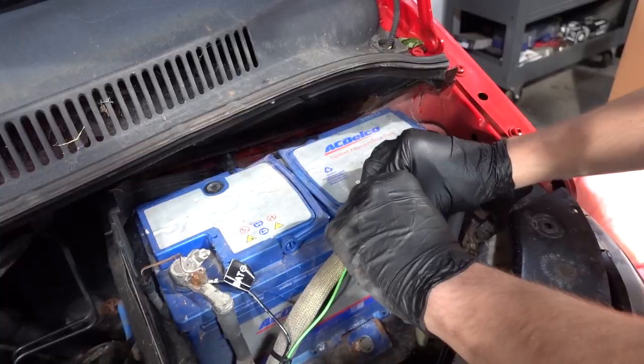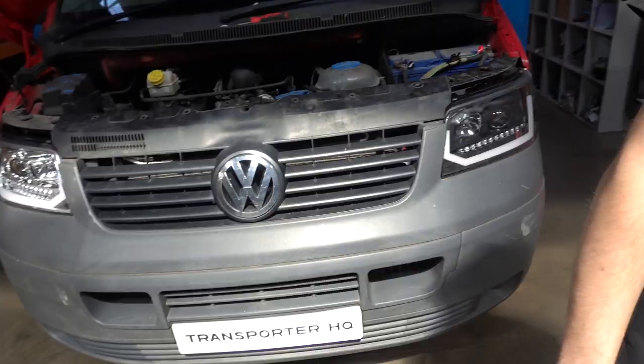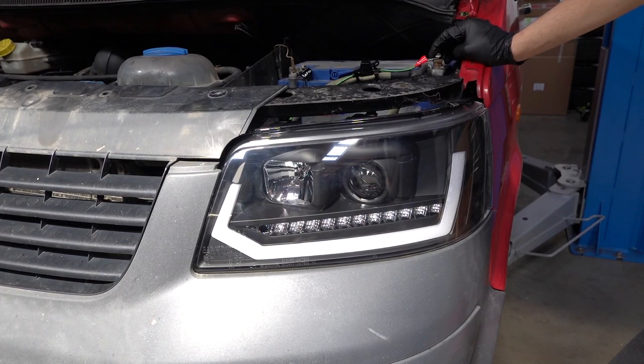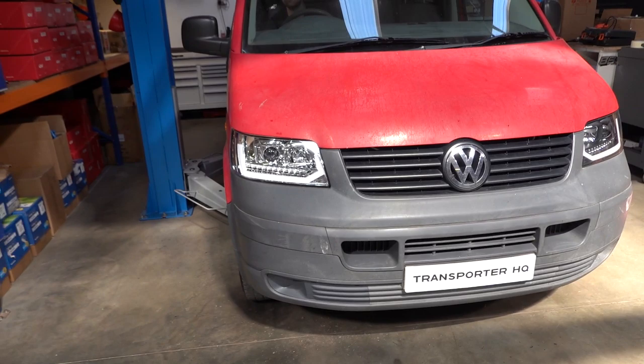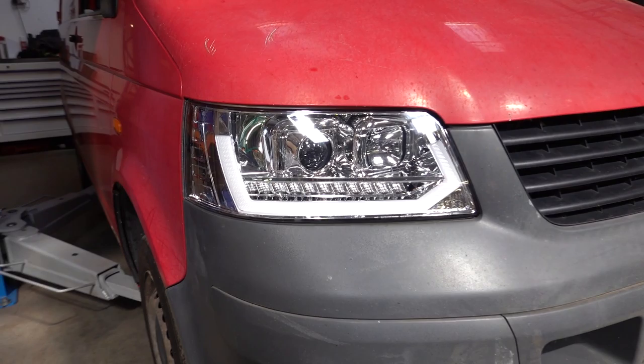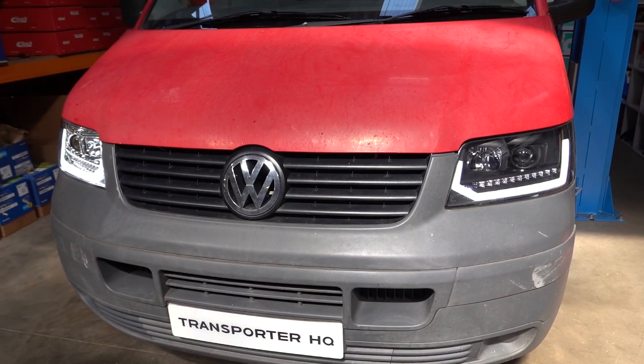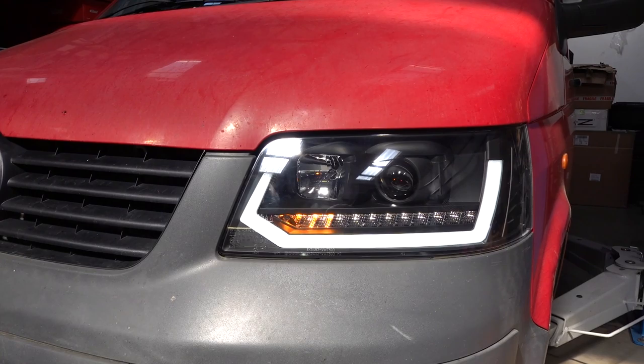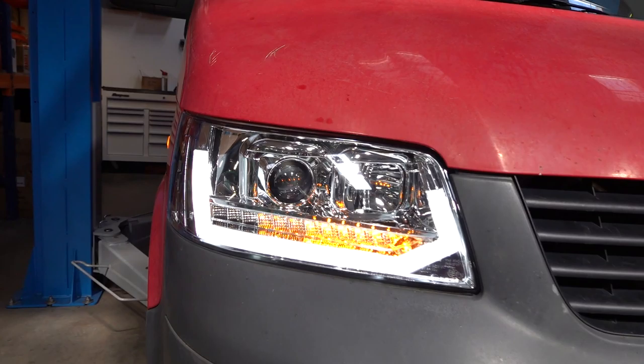Once that's all set up and neatly packed away, put the fuse in and the DRL will start to flash — it should flash 10 times. Then wait for up to three minutes and it should flash again three times. So that's the DRL power box fitted. If we just turn the engine on, you'll see the DRL will come on after a few seconds — they're both on now. And then if you go to side lights, you'll see they dim slightly — that's a legal requirement. Then put the indicator on. And the same again over on the chrome one — indicator on.